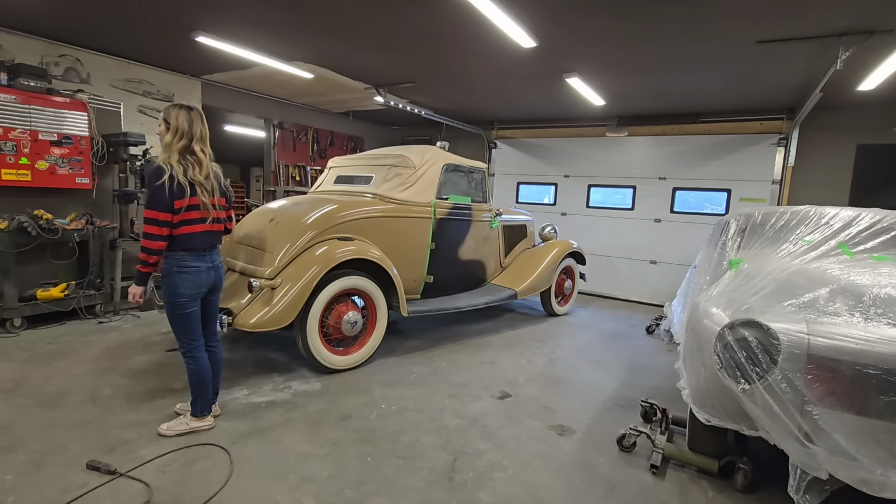Now, as you can see, I'm making the repairs kind of, what can I say, as quick and dirty as I can. What I mean by quick and dirty is I'm not going through the primer process. I'm not going through all the 300 and 400 grit and the guide coat process and taping it up again, blowing it off. Not going through all that process. All I'm trying to do is make something look that much better than it was. So it's just kind of helping it out a little bit. We'll leave that dry for a second.